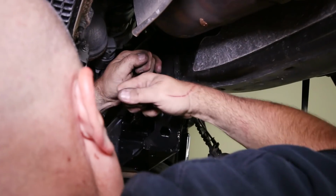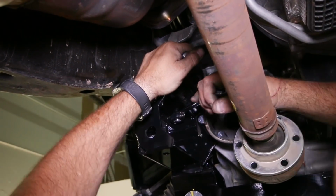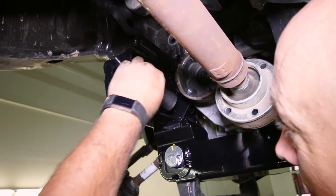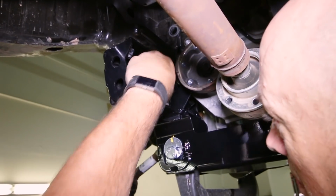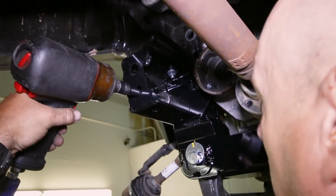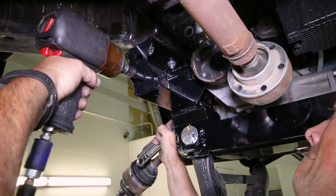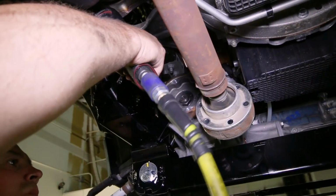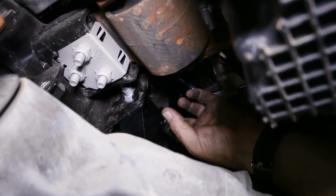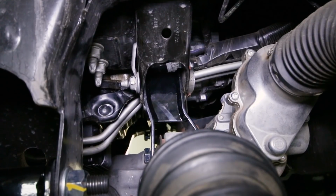After the control arms are in place, we can start to tighten all the hardware we left loose, starting with the sway bar drop brackets, the rear crossmember mounting bolts to the frame, the differential rear mounting bolt to the rear crossmember, the front differential brackets to the frame, and differential, then lastly, the front crossmember to the frame.